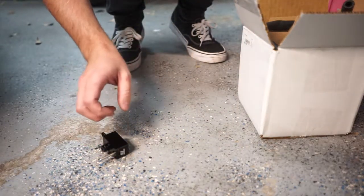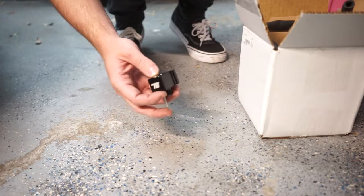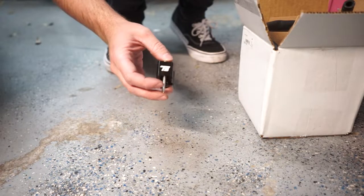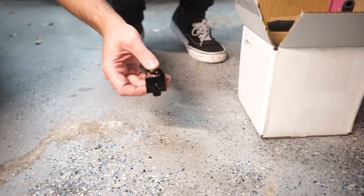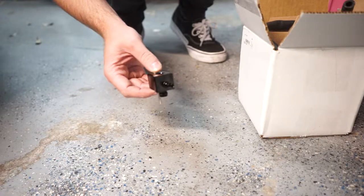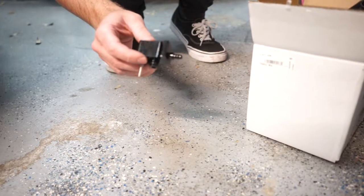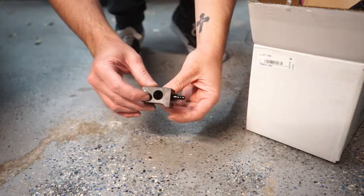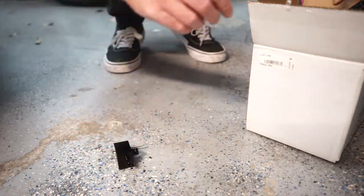With the analog boost setup, you need to tap into your manifold to get boost pressure and there is a spot to do it on the GTI, but I didn't want to drill into the port or anything. So this goes where your MAP sensor is — MAP sensor, either one of those, you guys will let me know in the comments. You're going to put this into your intake manifold, your sensor goes on top and it's got the little boost port. So that's what we're going to use there.